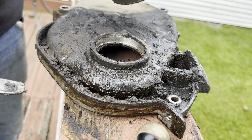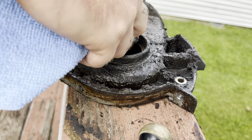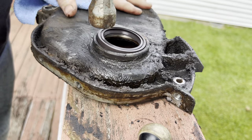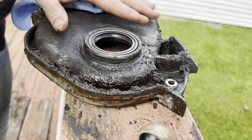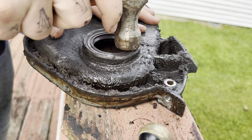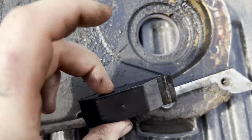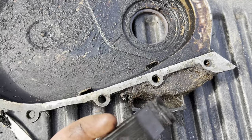Replacing the front seal is super easy — just took a screwdriver and pried it up out of there, then cleaned all the gunk out. After I cleaned it up, I just took a rag and softly seated it in there, then tapped it around with a claw hammer — it's light and doesn't mar it up too bad. I've done this for a long time and I've never had any problems with the seals leaking. And don't forget your timing chain guide — mine actually broke and I have to go buy a new one.